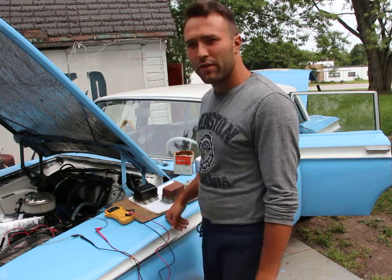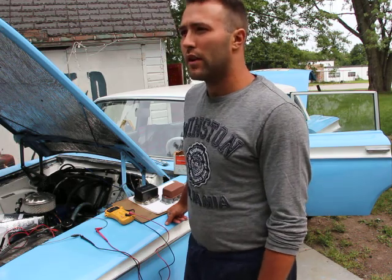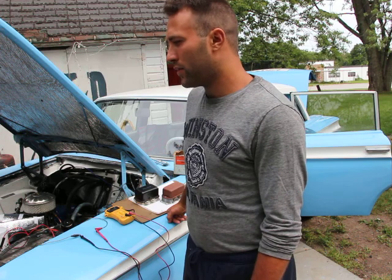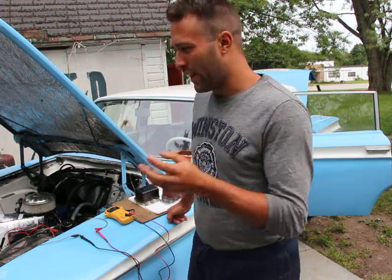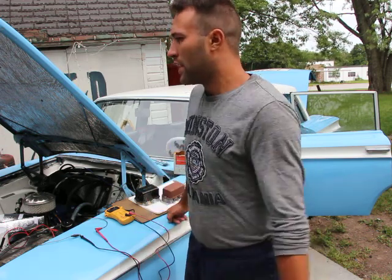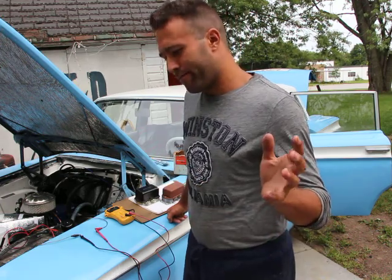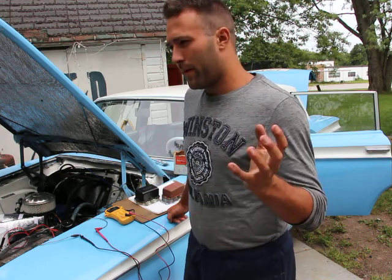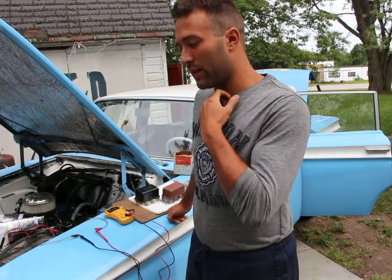And by the way, the batteries do go bad, even though they haven't been used. So if you get a brand new battery that's 10 years old, chances are it will not be good. Why? Because the battery is composed of lead and acid, and that chemical reaction is what produces electricity. After 10 years, the whole thing has just corroded itself and reacted, and there's little to no reaction anymore, just by the amount of time spent on the shelf.